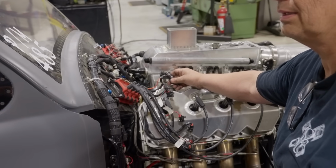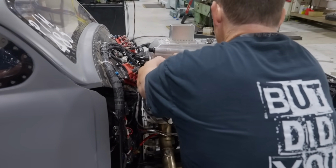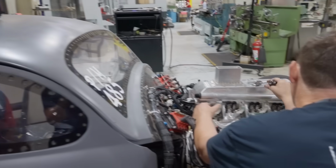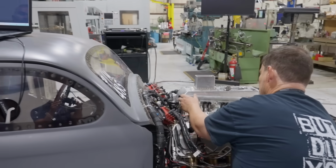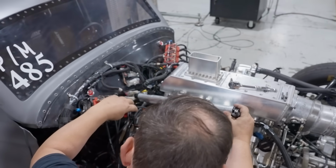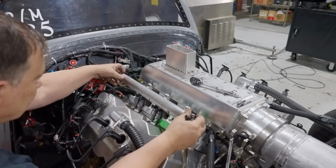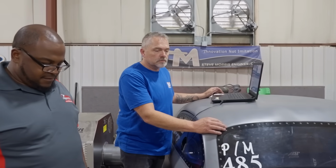You hear that? Yep. Oh, it's dead. Hook another injector to it. I heard the other one. Hold up. Yeah, so this is number 7. Oh, I see. You got him. There you go. You got him hooked up. So that injector's working. That other injector is not. Oh, you got a spare 100? No. So that's got a coil problem. The pintle is moving, the needle and seat's moving, something happened to the coil.